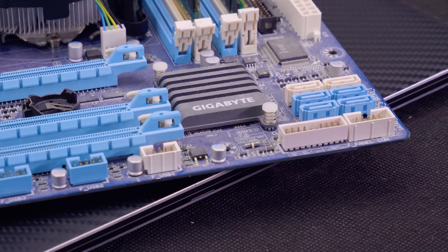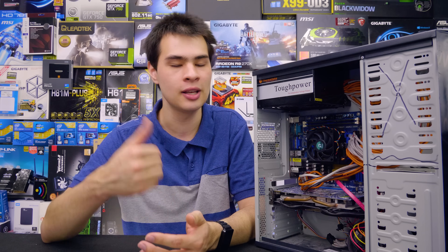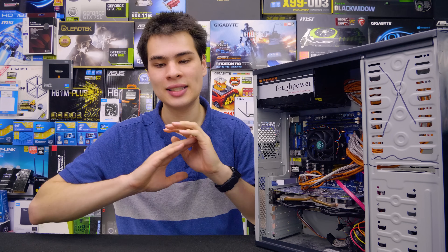Each one of these systems has not been opened for the stated amount of time — the XPS 15 hasn't had anything replaced for about one year, and this desktop hasn't been touched for about five. We're going to run Prime 95 to heat up our CPUs, get our baseline temps, change out the paste, and see whether there is really a performance increase. Before we get started, all the coolers and heat sinks will be blown out with compressed air so that testing is consistent across all systems.